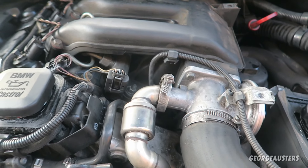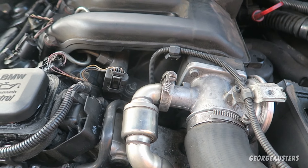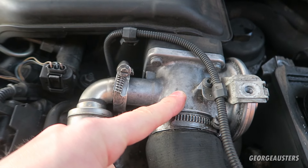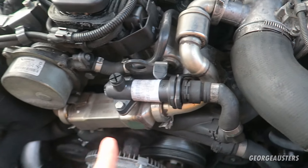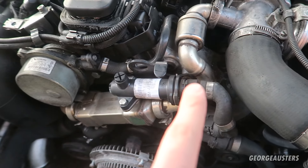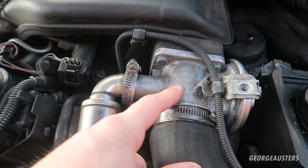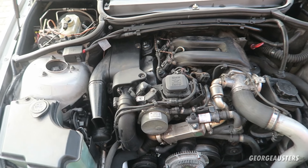In my opinion, if you want your engine to last and run at full performance without periodically cleaning out the intake manifold, the best thing you can do is delete the EGR. You can fit a straight pipe, and then it's up to you what you want to do with the cooler — blank it off or completely remove it. At some point I'm going to be doing a full delete on this, but yeah, EGR is a very common problem on pretty much all diesels.